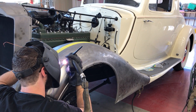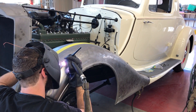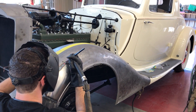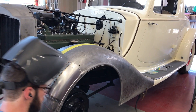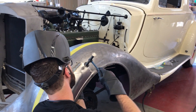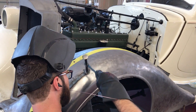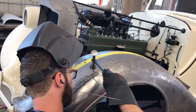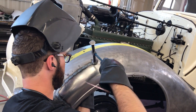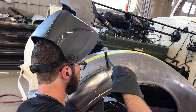In the old days we used to use the oxygen and acetylene torch and hammer-weld it, but nowadays with great welders out there like a Miller Dynasty, we can weld longer beads and control our heat much better. Instead of that half to three-quarters of an inch with the oxygen-acetylene welder, we can weld almost one-inch beads, but we still have to come back with our cold hammer and dolly, hit that hot metal, push those slip plates back together, and shrink it back down to where you need it to be.